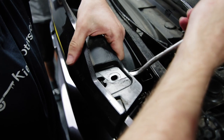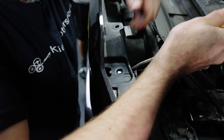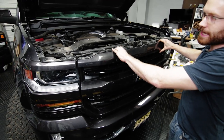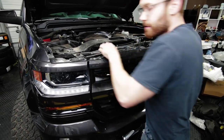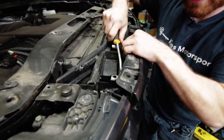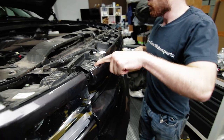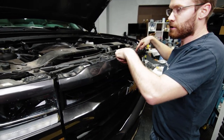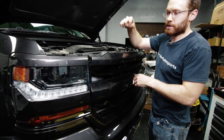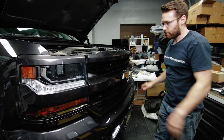On either end is a little tab that holds the grill back. So if you pop that up and slide it forward — we have the top released right now. Make sure these tabs stay popped out; they have a tendency to want to pop back in. There is one on either end where you have to lift up, and then two in the middle, basically right where the screws are. There is a tab right in front of those holes and it sticks down — you have to lift up and pull out. Alright, so we have the top released.